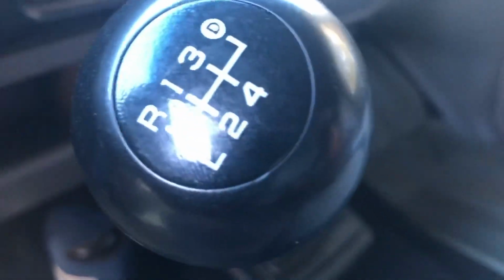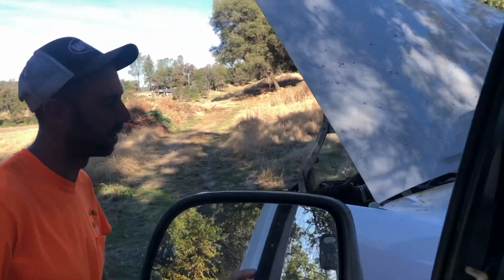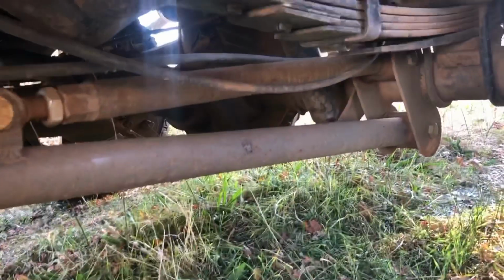That's a 02 ZF 6-speed. ZF 6. Did all the factory clutch pedals and everything go right in the Bronco? Yeah, it all pretty much bolted in. So basically you got power windows, power door locks, everything's working. Everything works. And then what rear axle's in this thing? That's out of a '09 F-250. So that's a 10.5. Yep. From a '09, factory disc brakes.